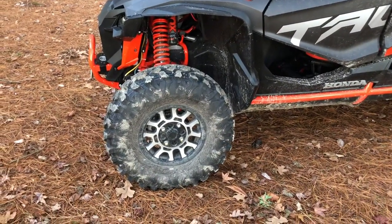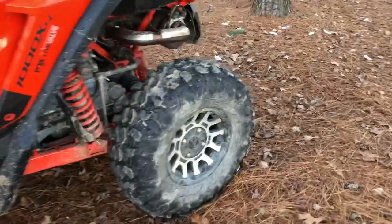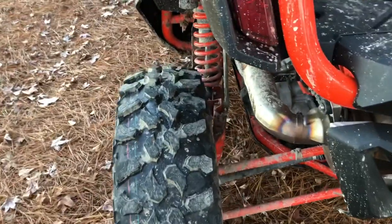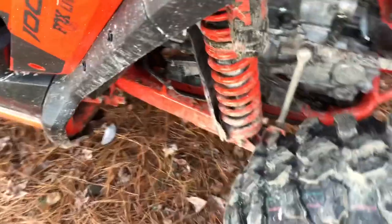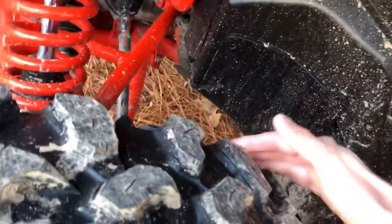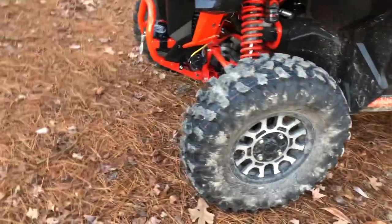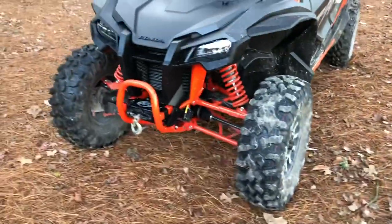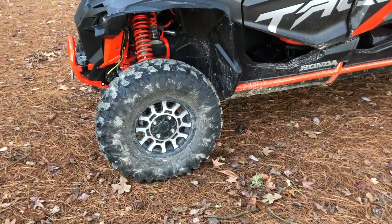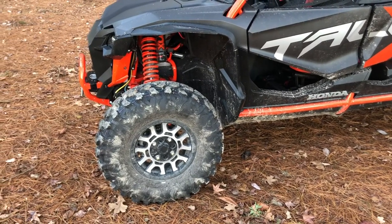The factory units come with 28-inch tall tires. We ended up upgrading to 32-inch Carnivores. These tires do really, really well — I'm impressed with how light they are and how well they grip. I was a little concerned putting them on stock rims about the clearance between the lower spring hanger and the tire, but that worked out. We did have a little bit of rubbing on the side when turning left or right, but overall very little and it's not really a problem. I do want to find different rims — it's hard to find the right offset since the front is different from the back, and I definitely want a beadlock.